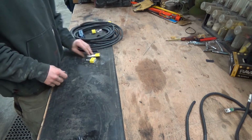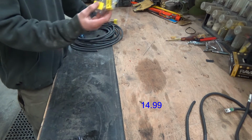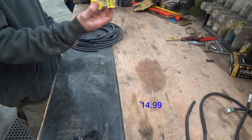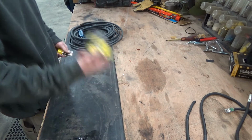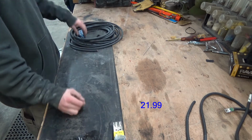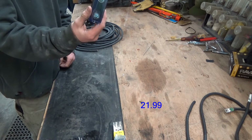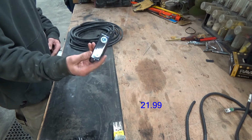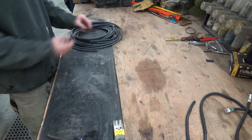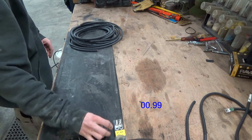And then from Lordco we have all the butt terminals. Yeah, well, it's whatever you want to, different trade names for them. Then we got 125 amp slow blow fuse that fits in this. You just can't handle the sexual innuendo words, can you? No, in this fuse holder. And we got two grommets in case you're making your own hole in the firewall.